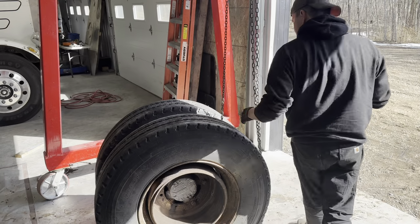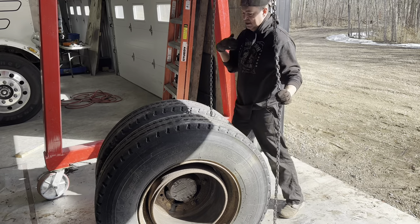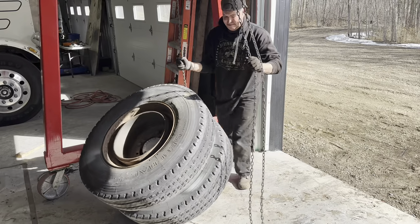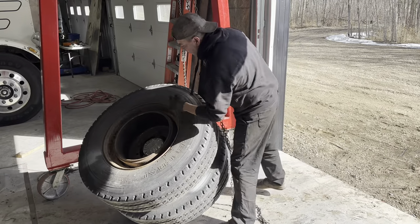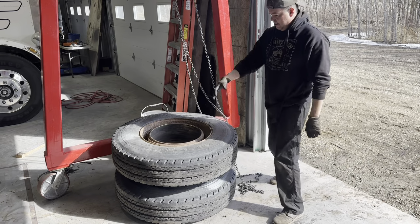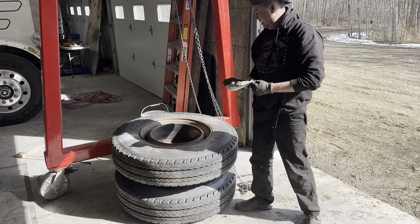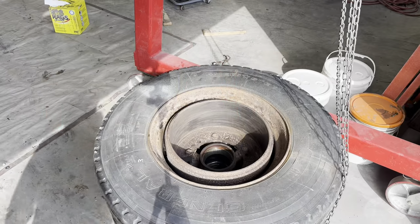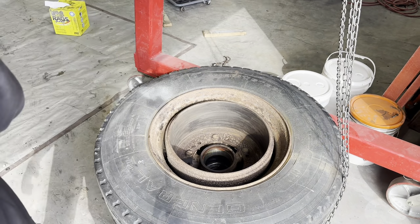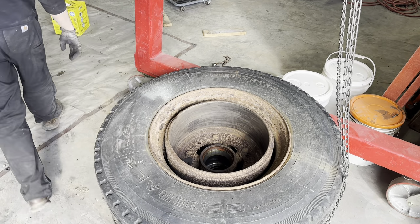Okay, so I'm gonna try and work smarter and not harder. What I need to do now is, I wanted to lay this over. Oh, these are heavy, stupid heavy. Lay this over and then put in the wheel seal, and lift this up and put it back on its bottom again. Okay. Yeah. So as you can see, I was smart enough to number all the tires, 1, 2, 3, 4, all the way around, and then I numbered the hubs as well, or the spindles, and then I marked out the bearings, so I know which one goes where.